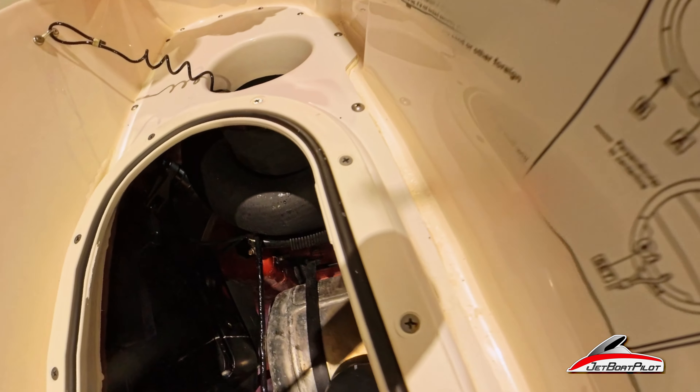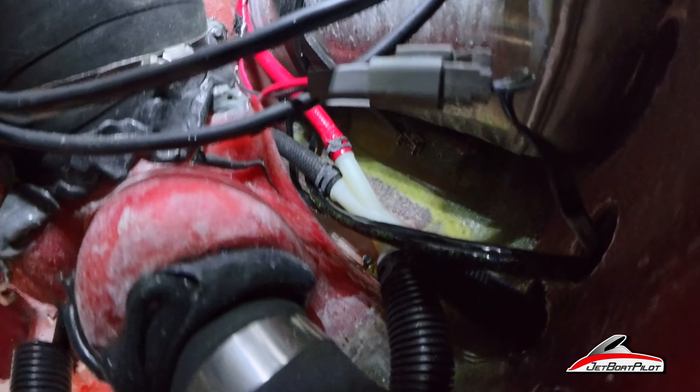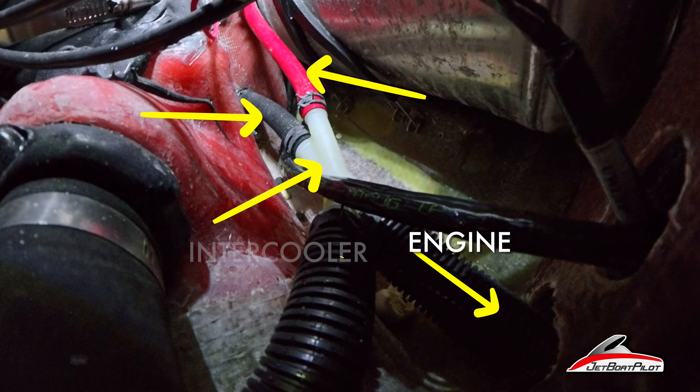Let's check out the port side motor water pickup on the 255 FSH. Come in here and go around the back side of the jet pump. You can see right here there's a white nylon splitter that the red hose is connected to, and there's a black hose just below the red hose. That black hose is what you would want to clamp down on. However, you can't really get access to it from this mechanical access port without a lot of trouble. It's just not practical if you're out on the water and just trying to clamp off this line. So coming off the end of the splitter, there are two black lines going inside the engine compartment, connecting to the engine as well as the intercooler.